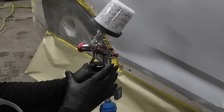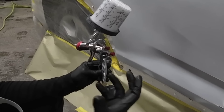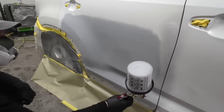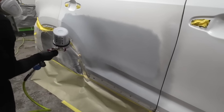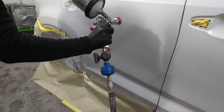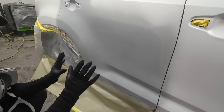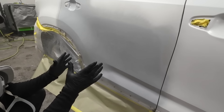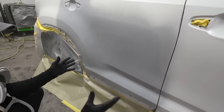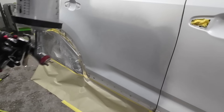The air pressure — I'm going to run this at about 20 PSI for sealer. This gun only uses about 3.5 to 3.9 CFMs, so you need to adjust your air pressure a little bit higher than you would on a conventional gun. Just because I'm adjusting the pressure up does not mean it produces more overspray — it actually produces a lot less. As an example, this week I sprayed an entire hood with two coats of clear coat using only eight ounces of clear. Since this is a very thin sealer coat, I'm putting on two coats — a light to medium first coat to introduce the sealer to the surface, then a medium second coat. We'll let it flash off for about 10 minutes.